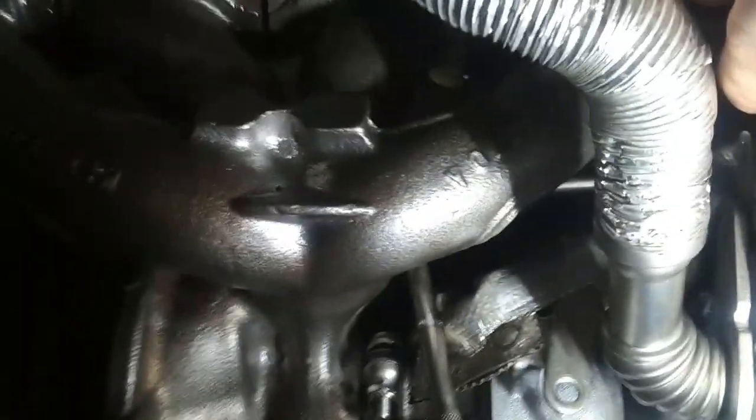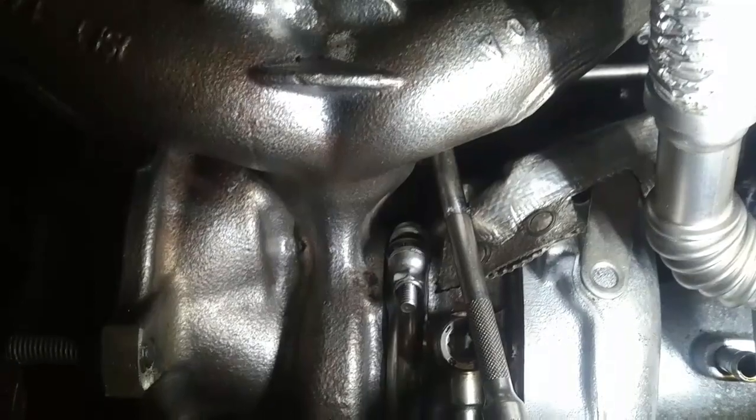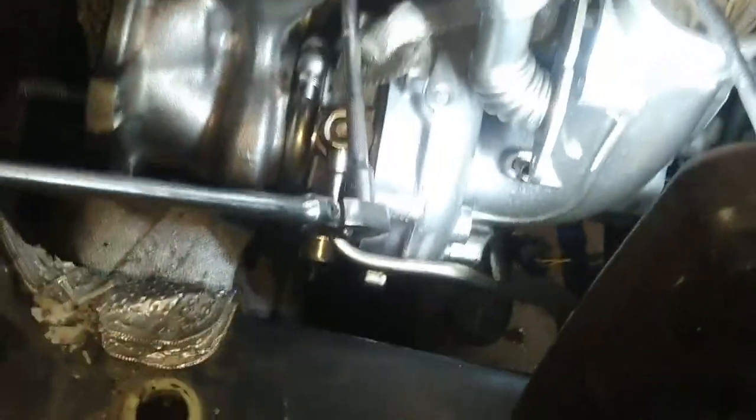So it turns out this exhaust manifold is wider in this area here. So to get at these two bolts, there's one bolt you can see in the video camera there. It's nearly impossible. Before I was able to go in with a straight socket, I left the stud out of this side of the turbo so that I could get at that one back there. That one's tight. But this one on the front, I had to use a borescope to look at it while I tightened the nut up from the outside. I managed to get it.